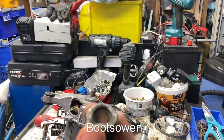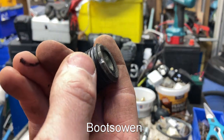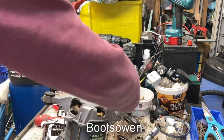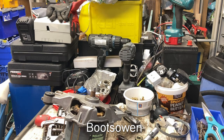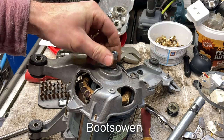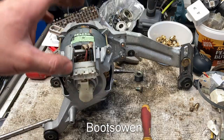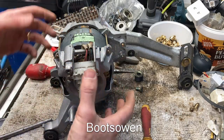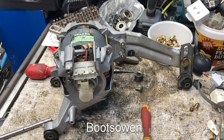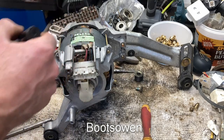That was quite unspectacular. A slight bit of damage to the pulley, but not to the running tracks of it, so it'll be okay. Very good — this is all going very well. It's unusually successful. There's a slight taper on that, and that's what it sits up on once it's screwed down. So it should just be a matter now of taking out these screws, pulling the motor apart, and getting the bearings out. Sounds very easy, doesn't it? Let's put a mark on it so that it lines up, just so I know where I'm putting it back together again.